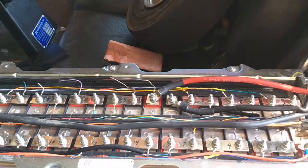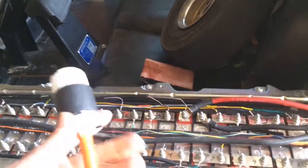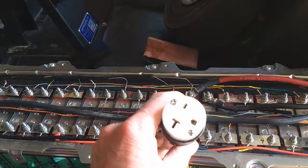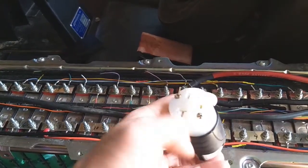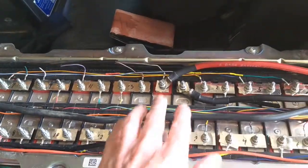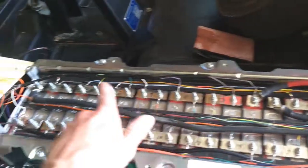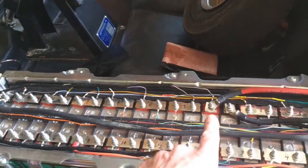What I'm doing now is I'm going to hook up my charge cable — I got this guy right here. I chose this charge cable because it's a funny charge cable so that nobody actually plugs into this one. It's a 20 amp outlet, but you can see it's got the cross and one blade going the wrong way. So I'm gonna hook up to here and here.